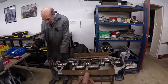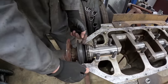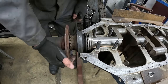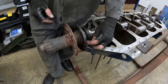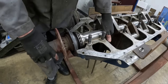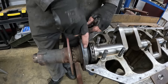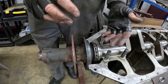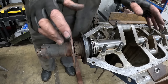Then we chopped that off completely, and we made a great big lump of metal that was that size there, and actually getting bigger here for the flywheel. And then we filled up the holes that hold that on. Then we turned a spiral, a thread sort of thing on there, going the opposite way, so when the crankshaft turned, it sent the oil back. And there's two keyways in there holding all this lot. So we used the two keyways, we heated it up really hot and dropped it on one chance, and it went on beautifully. We were very lucky.